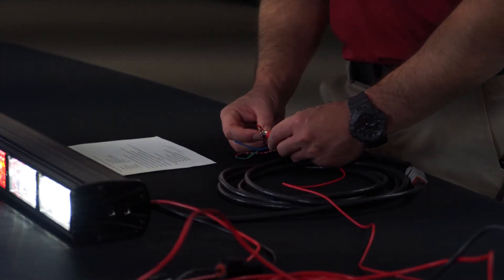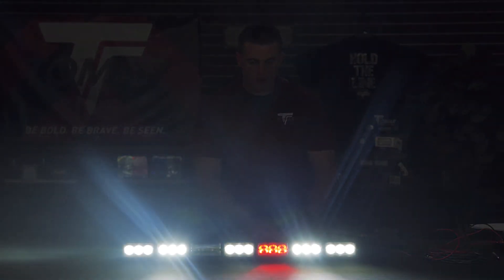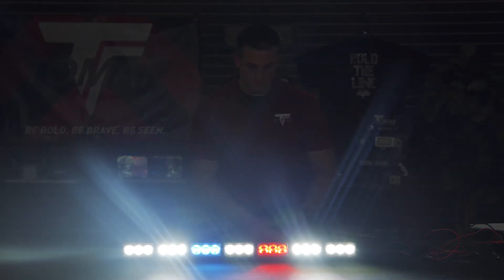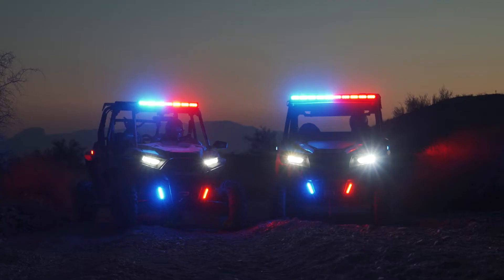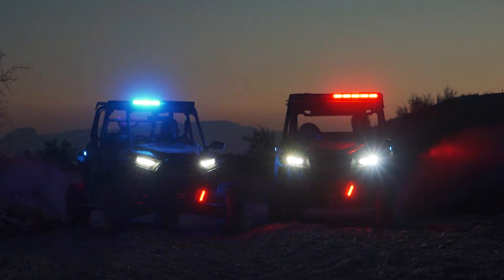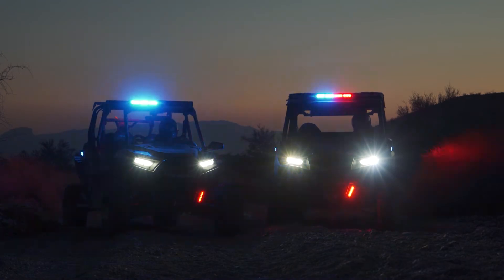Connecting the brown and white wire with your orange wire not only gives you your white illumination, but also activates your emergency red and blue. This can also be used in your steady burn function. The TRT bar warning function is SAE compliant and is capable of being 50 state legal with your combined California steady.